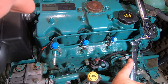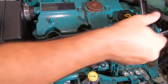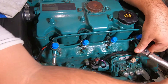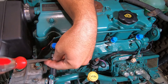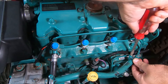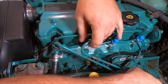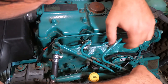You'll need to counter-hold the injector when you torque on the retaining nut. The manual doesn't specify the torque for these retaining nuts, but I assumed it was the same as the injectors themselves. Use a torque wrench to tighten the screw in the banjo nipple - there's no torque specification for that screw, however I went with 10 newton meters as a general guide. Then replace the fuel return hose onto the fuel return rail and the fuel supply hose onto the banjo nipple. The fuel supply pipes get torqued to 12 newton meters - just spin the nuts down with even pressure top and bottom, then do the final torquing.